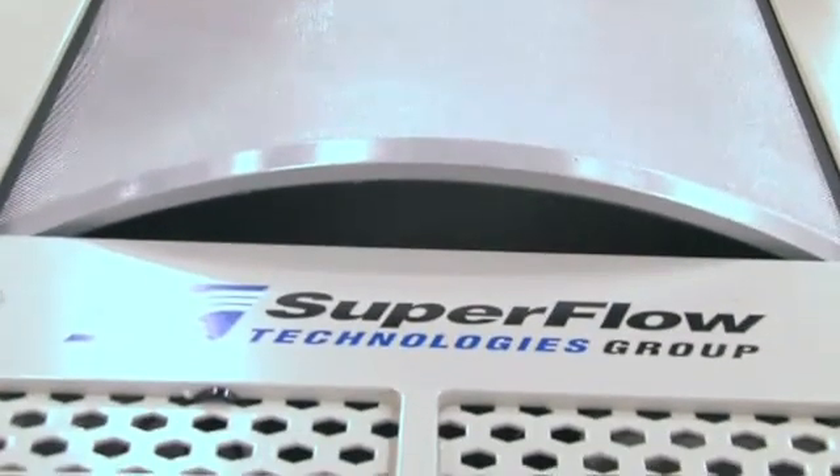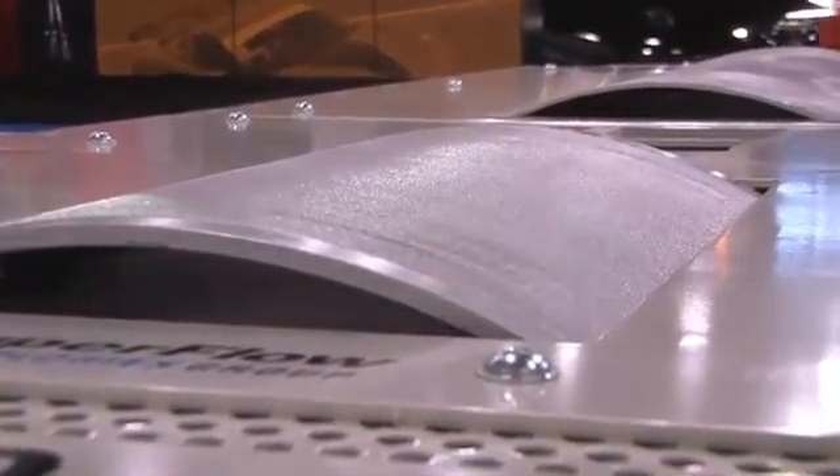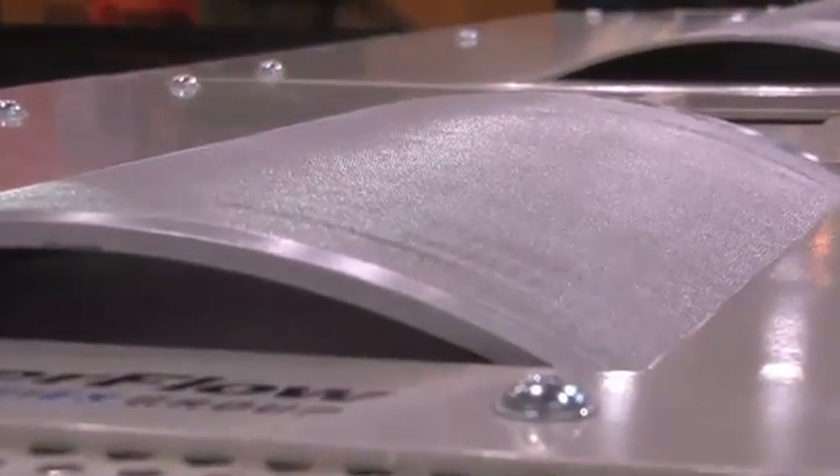Also, the big rolls give you good traction. Cradle roll systems will deflect the tire in two places and that puts a lot of heat into the tire, which equates to horsepower that's not measured by the dyno. The all-wheel drive model uses differentials in each roll set so we can actually measure the torque split on the front roll set and the rear roll set, which is important on all-wheel drive cars to be able to tune for drivability.